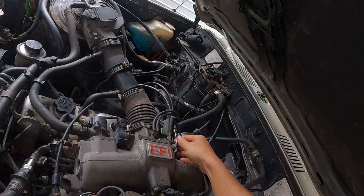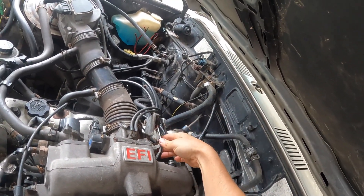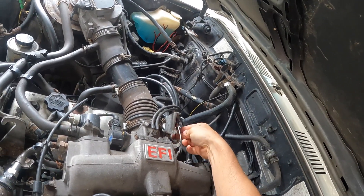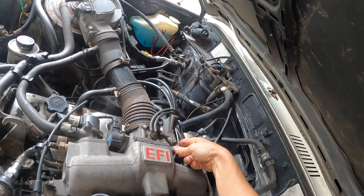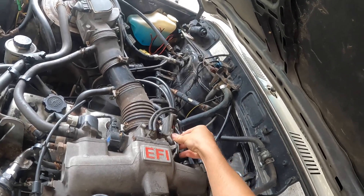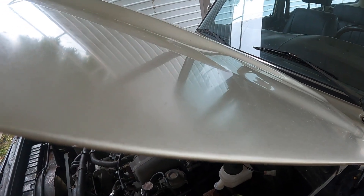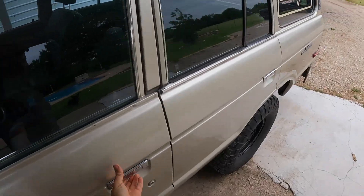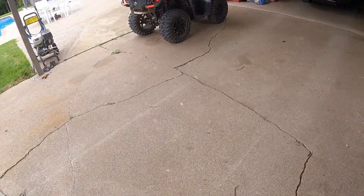Alright, let's take a look here. See that? It's got quite a bit of slack in it. It's got some slack too. What we're supposed to do is check — so with the pedal all the way down, verify that we're getting wide open throttle.